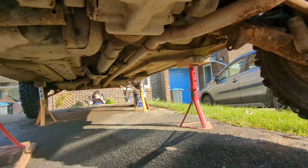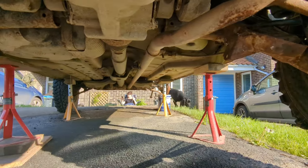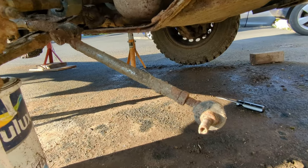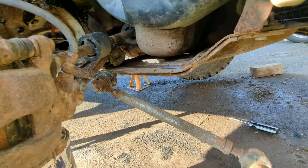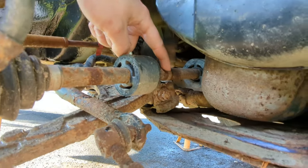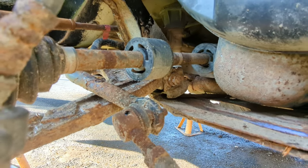This cat-back system was £250 and I was quoted £350 to have it done in stainless. The brakes are standard Panda 4x4 calipers with Emtek discs and pads. I've also fitted adjustable anti-roll bar links to bring the anti-roll bar away from the lower wishbone, which happens when you lift the car. Another issue is that the drive shaft will rub on the subframe when you lift too high — this is the reason why 30mm lifts are not a good idea and it's best to stick with 20mm.